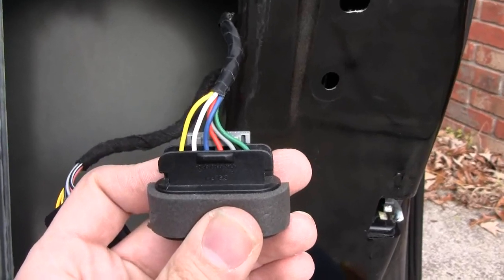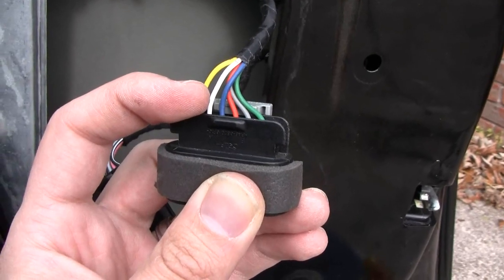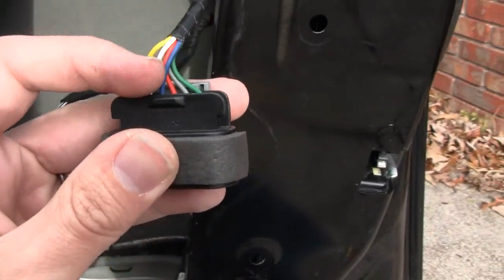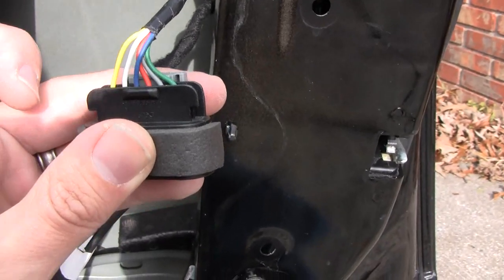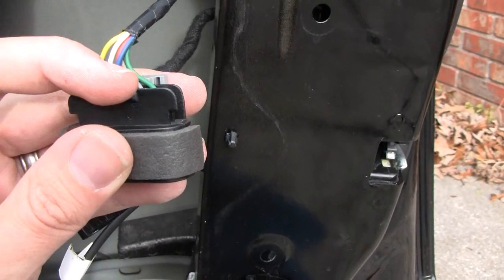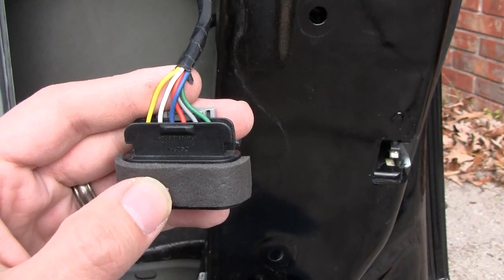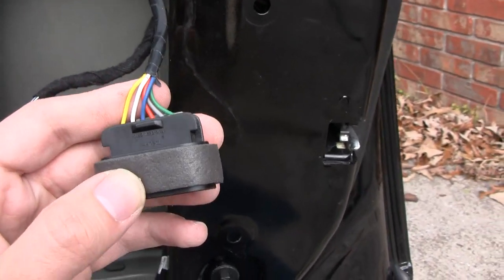This harness coming from the door switches has six wires. The yellow and white are not going to be used for the test — they are for the antenna that goes through the door handle to sense if your key fob is within range. The other four wires are two sets: the blue and orange wire are one switch, and the gray and green wire are the second switch. You're going to test for resistance between blue and orange, and then between gray and green. Once you get your leads hooked up, you actually have to pull on the door handle to see if the switch is working. If you pull on the door handle and you get resistance, the switch is working properly. If you pull on the door handle and the circuit remains open, that switch is malfunctioning.